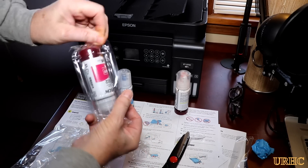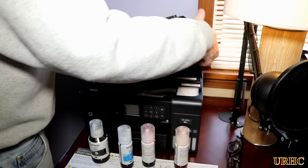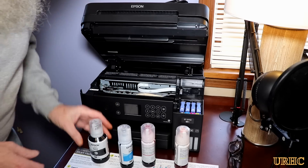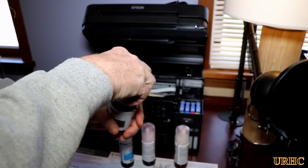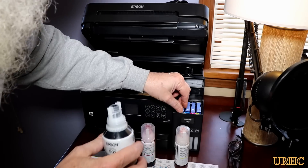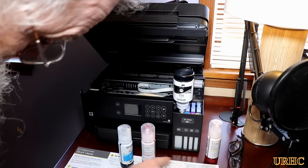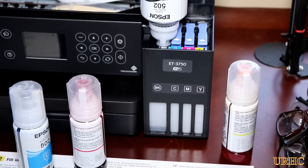This model has ethernet and wireless built in, so it's pretty versatile. They call it an office quality printer. To fill it up, you just open the top, lift up the scanner, open the ink bottle — these bottles are several ounces at a time, not just a couple milliliters like HP cartridges. There's a little cap with a seal on top of the tank, and you just turn it upside down — it's like a key that fits right in to make sure you've got the right color — and just let it sit there and it'll stop filling once the tank is full.